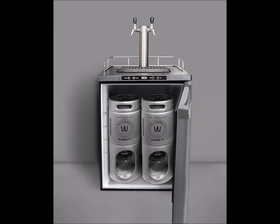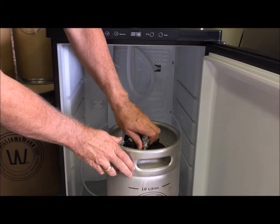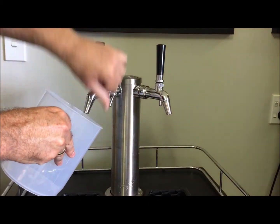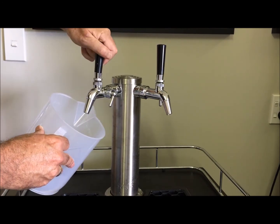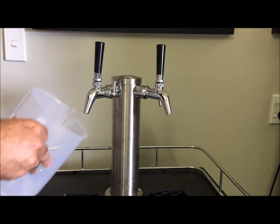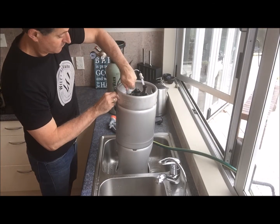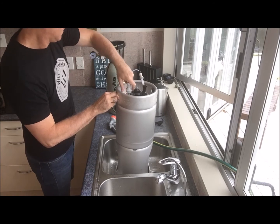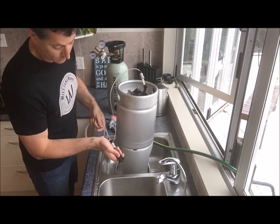In the case of a kegerator, you'll be attaching the beverage outfitting that leads to the draft beer tap on top of the kegerator. Once connected, open the flow controller and pull the beer tap to get a flow for 1 or 2 seconds. If for some reason there isn't enough pressure built up to get the hot detergent out, just attach your CO2 system to the gas import for a few seconds and this will give you the pressure to clean the beer line.